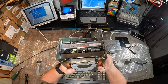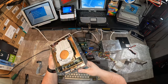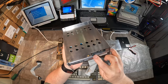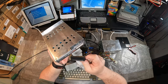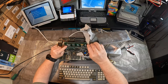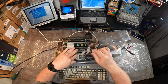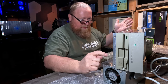This style of drive doesn't have any keys on it, so it's kind of hard to know which way to plug the cable. Pretty much always there'll be an indicator somewhere on the board that shows you where pin one is. On the bottom of our floppy drive it's actually printed — pin 34 and pin one will be over here. So pin one's going to be over here and I'll put the red stripe to that. Again, these aren't keyed like a lot of them are. On this board, it shows pin 39 here and pin one here. Same with the floppy — pin one is over here, so we'll put the red stripe to pin one.